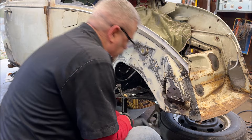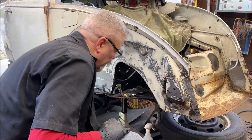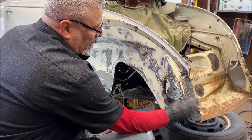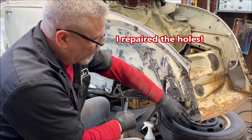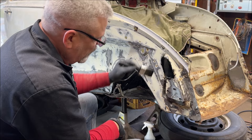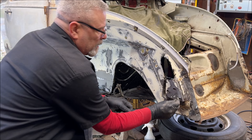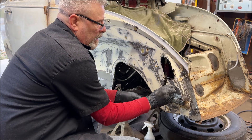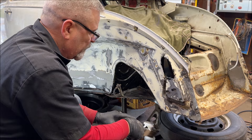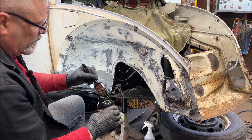This rust bullet is brutal. I'm going to put this down because you can't even get it off the floor. The apron covers this when the new apron goes over it, so I'm not worried about that being perfect. Let's start brushing on the rust bullet. Wind some bolts in here a couple threads, and then once you're done take them out and wire wheel them — because you don't want to clog those threads up with rust bullet and you're not going to get it out. You can get it out with a tap so don't be a wise guy.